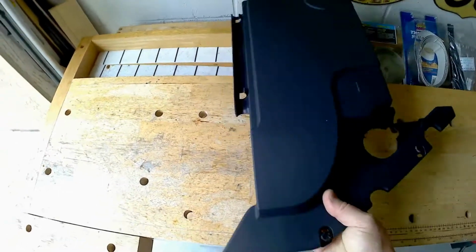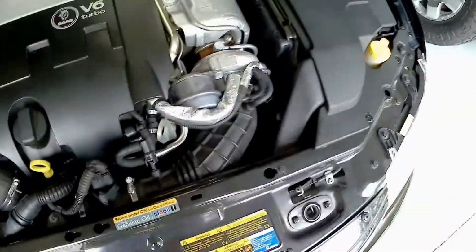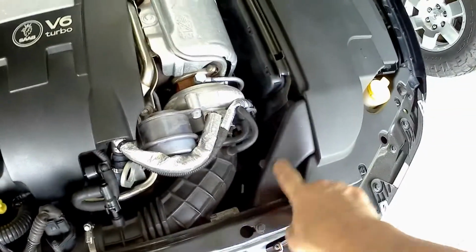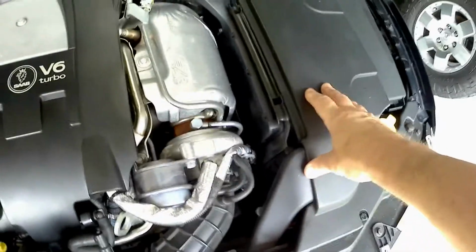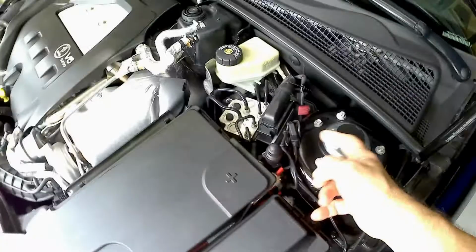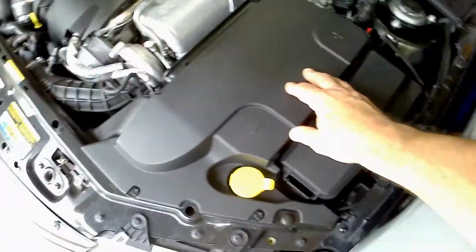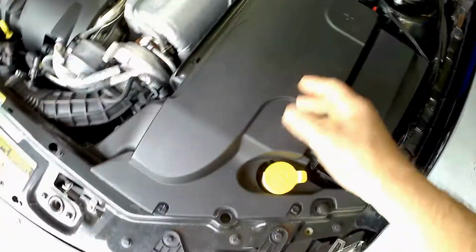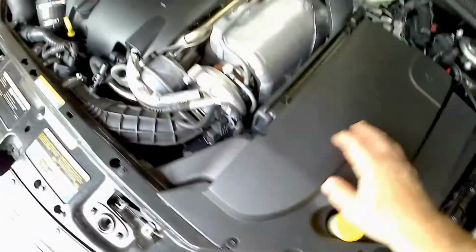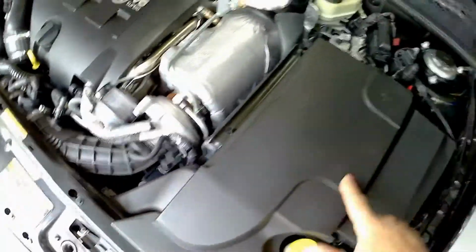The other thing this does is seal your battery, because just like airplanes and jets, there's an air intake here that goes into the battery compartment. That's what the cover's for. It circulates cold air, and it's exhausted back here. That extends the life of your battery. So this isn't just dress-up like some mechanics think it is, who push these in, smash them, and end up breaking the teeth. No, no, no. This actually serves a purpose. That's what this little ductwork is here for.